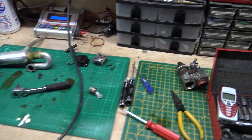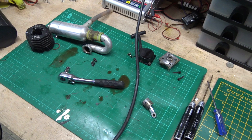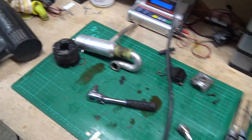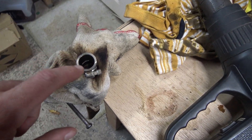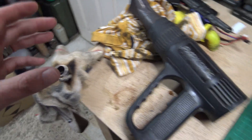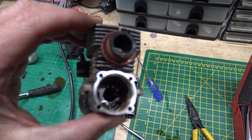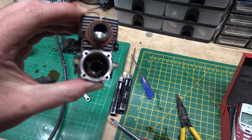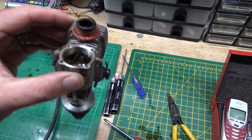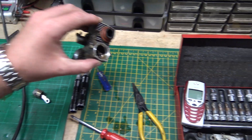It came with a monster truck and it didn't really run very well because it was quite low on compression. What I'd done was stuck a bit of oil down the well, down where the glow plug is, and that sealed it up and it ran briefly. We did determine that the bearings probably aren't a lot of cop in there, but there's quite a lot of goo and rust in there, so I'm going to clean all that out with brake cleaner and order them up.